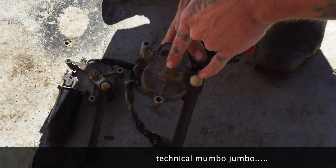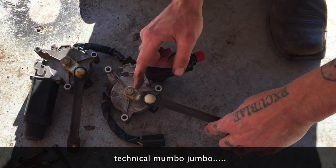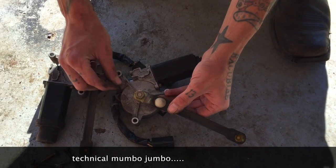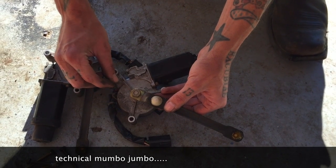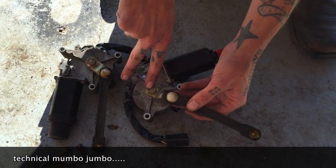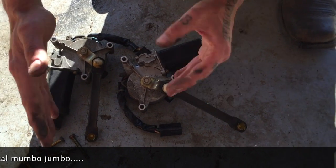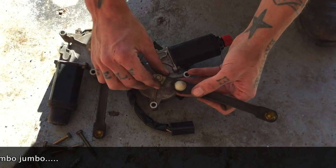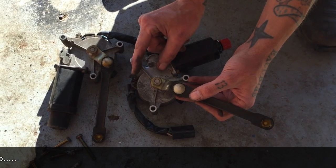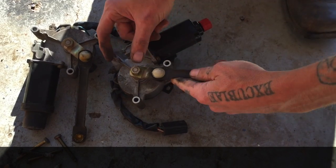You'll notice in the parts kits that you see online, there will be an adjustment lever. You cut and you weld — that shortens the throw, because this is headlight up, and at the total opposite would be headlight down. So under that principle, the distance between here and here is stock. If this causes the headlight to go up six or eight inches, whatever the headlight is stock, then shortening that is going to put that fulcrum point way closer down.